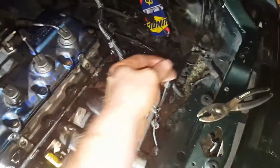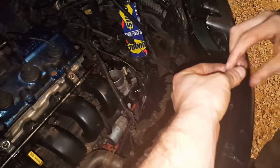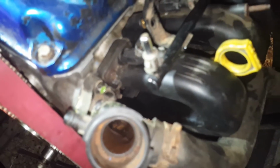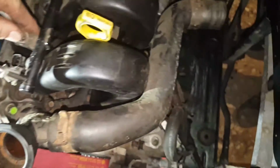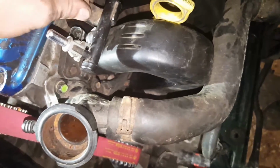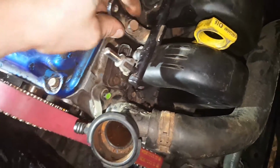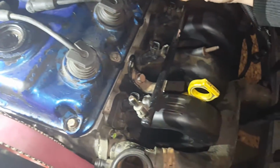Cool. Now put these bolts in there. I took a leap of faith. Feels like the injectors are a little long. If they are, we'll just make a little plate under there. Just snug it for now. Don't smash it down flat. Get one thread or two threads, it'll be fine. Alright, so we'll be back.